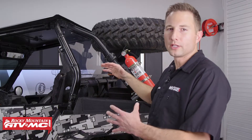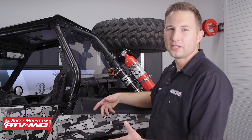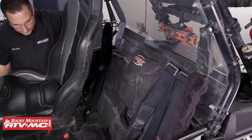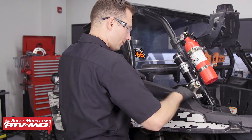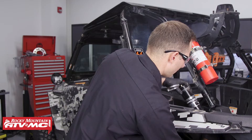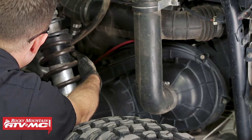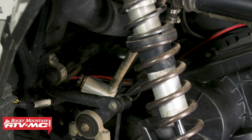The first thing we need to do is start with a clean machine. Since this is part one of our engine rebuild series, we're just focusing on removing the engine from the frame. We'll start by removing the seats, then remove some accessories from the rear since all the bodywork needs to come off to gain access to the engine. Next, we'll remove the pre-filter covers, remove the shock line covers, and loosen the clamps on the shock canister. We'll feed the canister down and route it all the way down by the skid plate so it's not hanging by the hose. Repeat these steps on the other side.